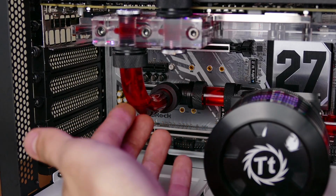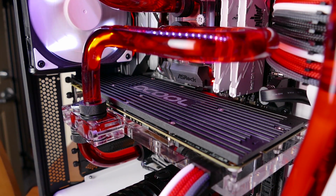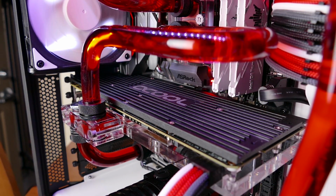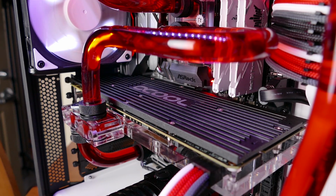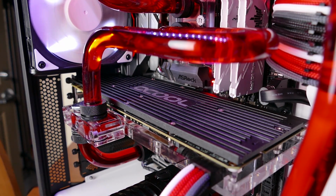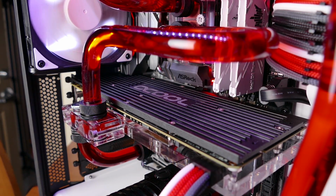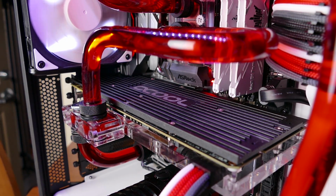And from the pump, a couple of 90-degree fittings lead directly into the GTX 1070, and this is a Thermaltake GTX 1070/1080 reference PCB block. I did have to remove the Thermaltake backplate though and fit the AlphaCool one, which is also a bit weird because these are competing manufacturers when it comes to custom cooling gear. Nonetheless, it wouldn't fit the Thermaltake one with the ASRock Supercarrier Z270 motherboard, which I'm using in the build. You can check out that review right here.